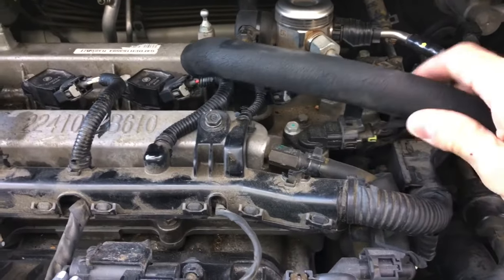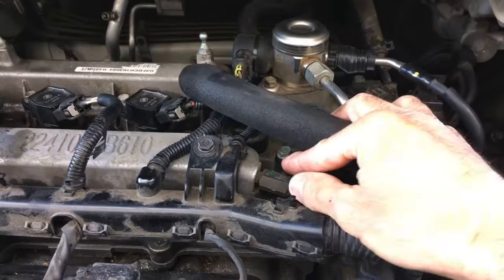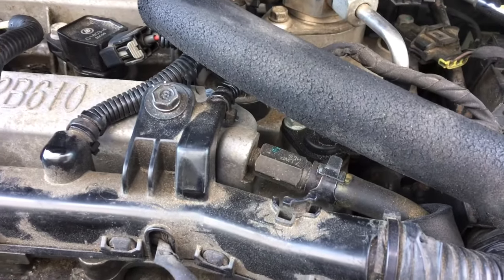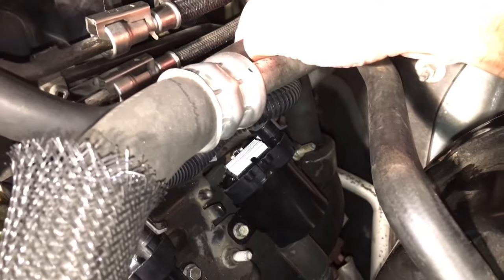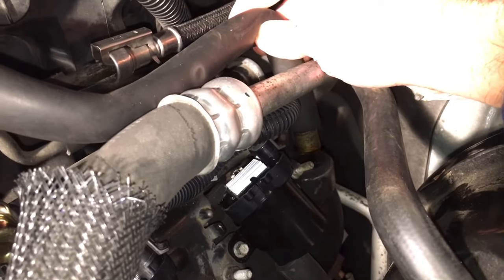On this vehicle it's a little bit tucked back in here, but you'll see it — here's your valve cover and it's coming in. Now this one, if I can get a close-up, you can see it's threaded because this one actually screws in. Some of them you can just pull out, as is the case with this one here. This is the vacuum line port — you can just pull it straight out, and that's your PCV valve connected to the vacuum hose.